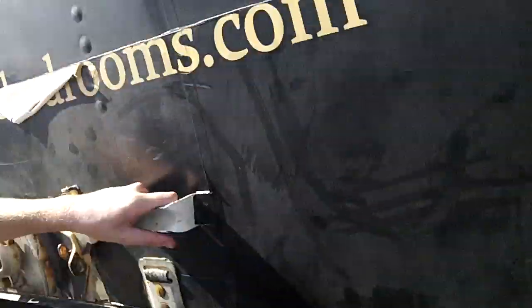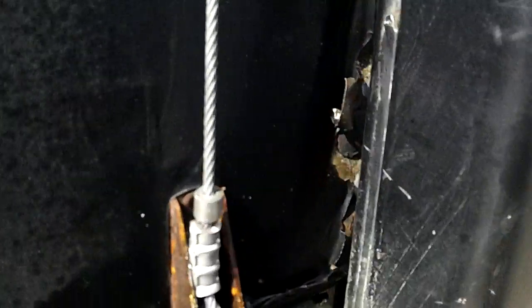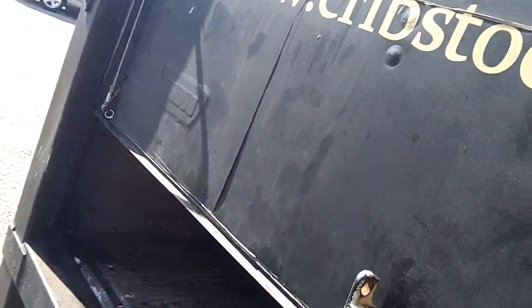Here's a truck trailer door. We put on some new cables and some pins. These cables were broken off and this door is all cranked up and backwards, so we have a flashlight. Open this up here and see the cable comes up right on that spool. It's a little mini garage door in the back of a lot of trucks.